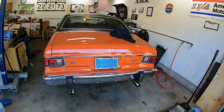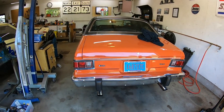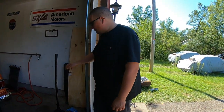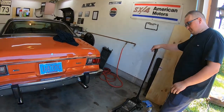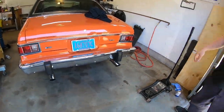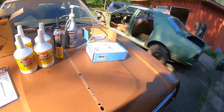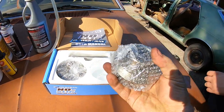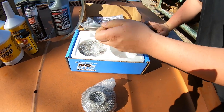So the first thing we do once we get an axle shaft pulled out, let's pull it out all the way, because we were originally just going to pull it out a couple inches. Let's pull a shaft out all the way and just confirm that it's the right spline count, so we don't get this semi put together and then realize we need to get the correct part. If it's not the right spline count, it would never go inside the part here. So we'll test that first.